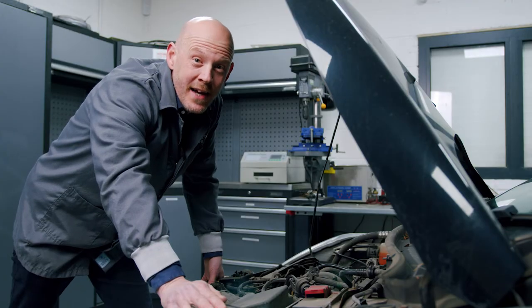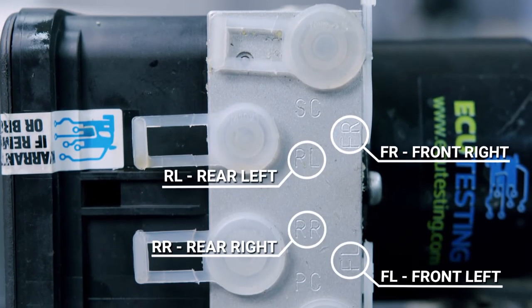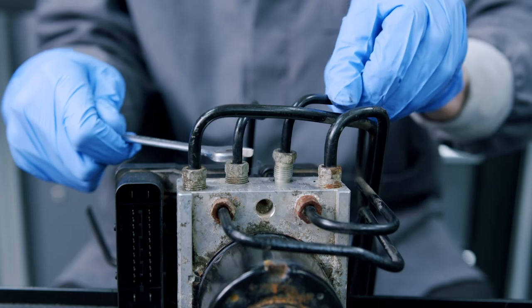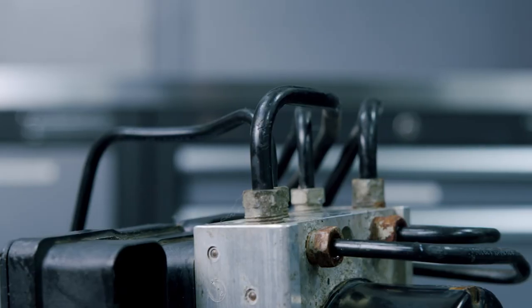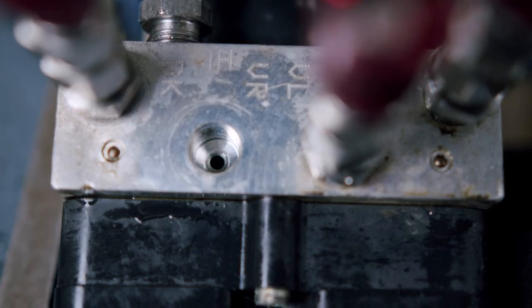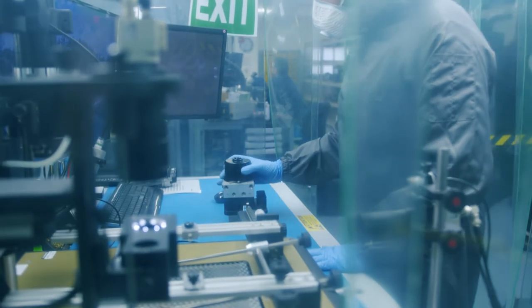Now let's check the flow of brake fluid at the ABS unit. First, find the correct brake line for the affected wheel — these are often engraved on the ABS block housing, as shown on screen now. Next, remove the brake union from the ABS port. Pump the brake pedal again, and if fluid is present at the ABS port, then this could indicate you have a failed brake line. However, if little or no fluid is present at the ABS port, then you have a failed ABS and you need to send it to us for a rebuild.